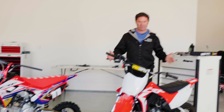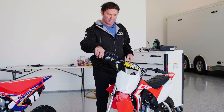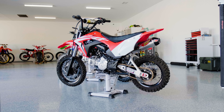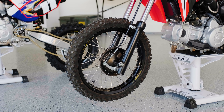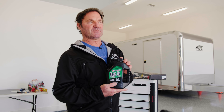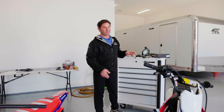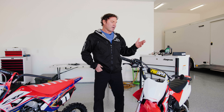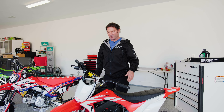For this 2020, we rebuilt the wheel set and put in their springs and dampeners. Another important thing when you do the fork builds is the fork oil weight. If you're a bigger rider, you might want to go with a 20 weight — Maxima has a 10, 15, and 20. If you're 200 pounds riding these bikes, I'd probably go with the 20. If you're 130–140 pounds, maybe go with a 10, and 15 would be a good in-between. That's going to help you with compression and the spring.